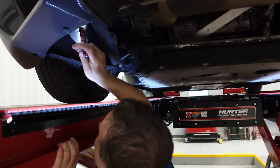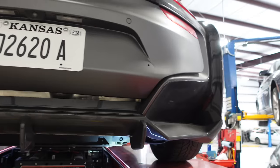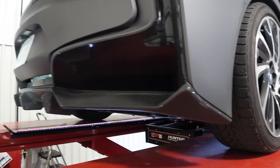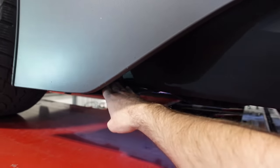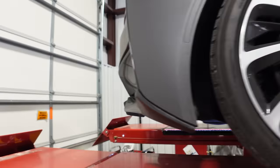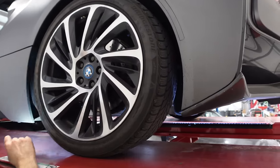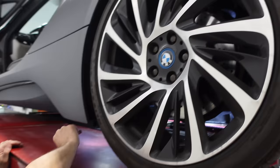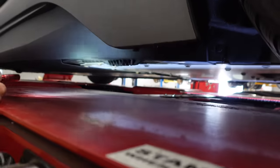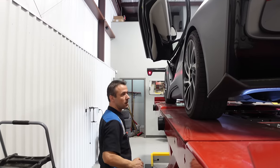More power to whoever's going to buy it. Now you can sell it with confidence and say this thing's in great shape. If you look at the back end, there's nothing wrong - nothing is out of alignment, there are no wrinkles. There's an aero piece missing on the other side, which makes me think it was the driver's side. Gap check - about two and a half fingers. It's super straight. Everything fits well. That little piece is held on by a push fastener and the push fastener's still in there, so maybe it just got ripped off.